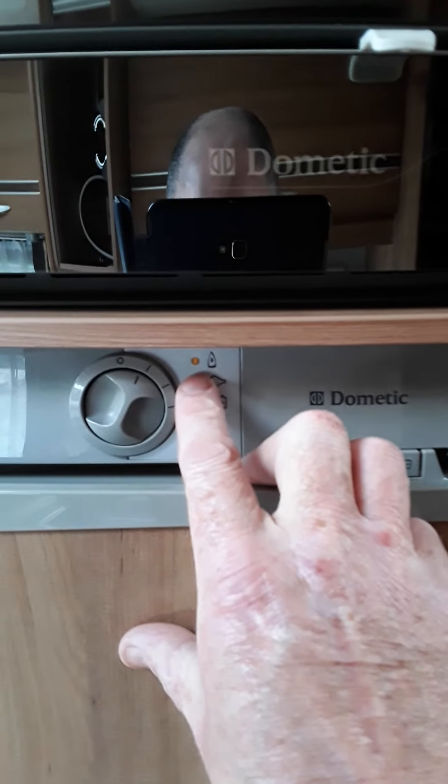We're going into the boot area here. Looking in that wee hole there you can see our red valve - that's your frost valve for your heater. At the moment it's in the up position, which is the correct closed position. Now at 2 degrees it'll drop down by itself, and what that does is drain all the water out of your hot water heater onto the ground outside. You can see the water coming out there - that's your valve pushed down. To correct it, just pull it back up again.